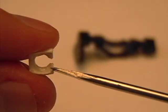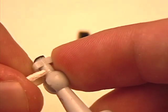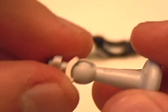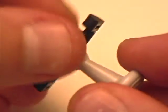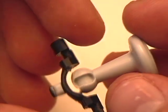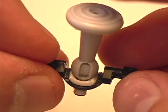Here you'll notice I also filed it around the edge so it would fit a little better with the ball. It's not a perfect fit just right out of the box - I also had to file a little bit on the inside so it sort of complements the sphere shape of the ball. When you put the black piece on there and file everything just perfectly, there's no friction, it's held up perfectly by this black piece. This fixes the first problem of the analog stick - that it falls down. Now the analog stick will never fall down. However, the second problem is the worn-away bearings on these black pieces.